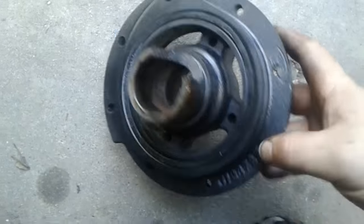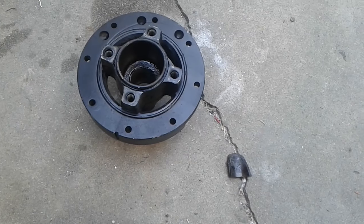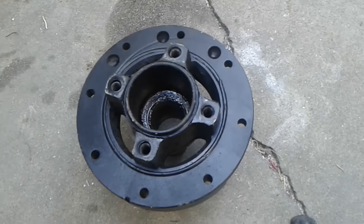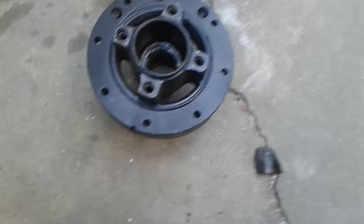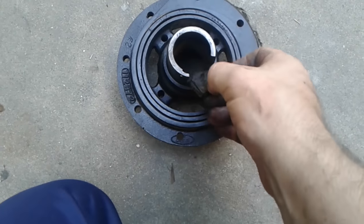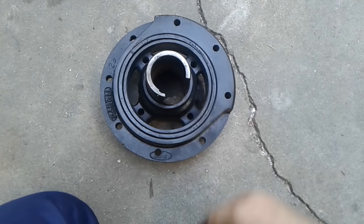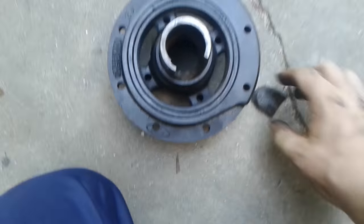This was a junkyard pulley — you guys saw it in my other video when I got it off that van. Alright, that's the end of this video. At least I know what the problem is now — why it was wobbling. It wasn't actually the pulley itself, it was the bad harmonic balancer. Hopefully something else in my engine didn't cause that — it's odd.